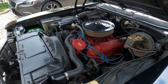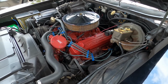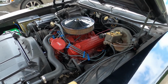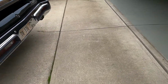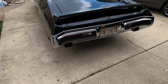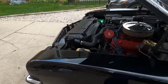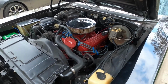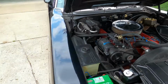Yeah, the carburetor adjustments, she's definitely much happier. Much less on the rich side when it's idling. Just runs crisper, down low and in the mid-range. Very happy. Got a big cam in here, so that's part of the issue. I'm running about 6 inches of vacuum only when it's at idle. A lot of overlap in the cam, so it's a big help running that lighter spring in the primary piston system in that carburetor. Real happy with the way that turned out.